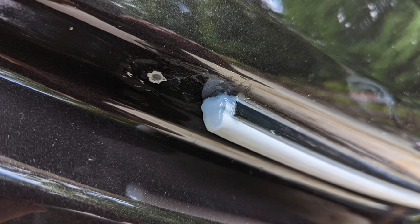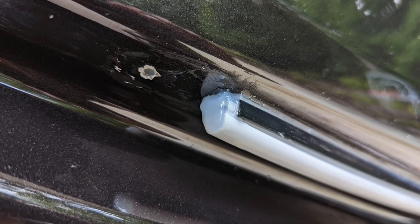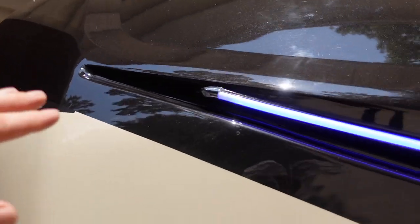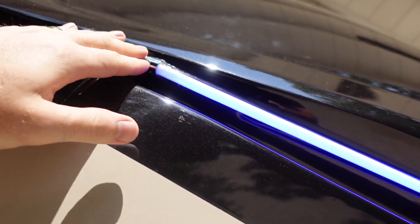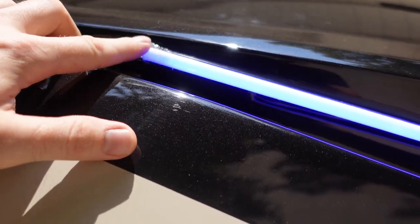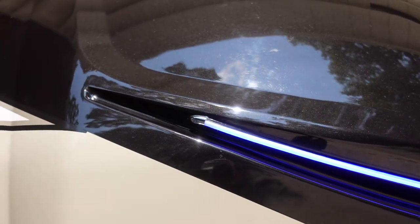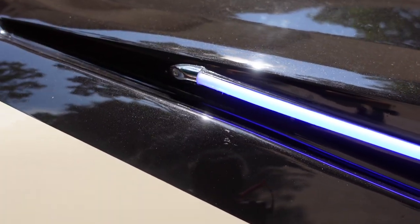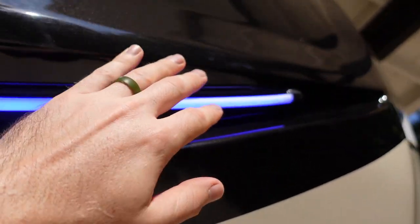This time I let it dry overnight and came back the next day to re-inspect both ends before putting on the chrome-colored caps. Double-check that your chrome caps are fully covering both the white vinyl tube and the black track — think of them as a primary line of defense against water intrusion. If your cap has a gap like mine did, cover the old screw hole with more silicone and use the existing self-drilling screw to make a new hole in the correct position. Then once the end caps are mounted, I used more silicone to go around the chrome-colored caps just to make sure no water could even get past the caps themselves.